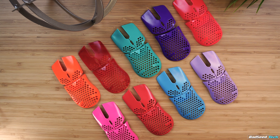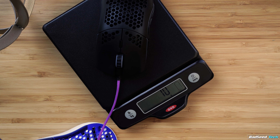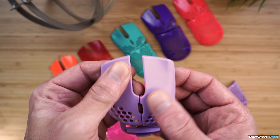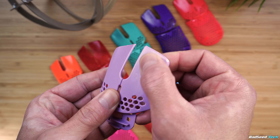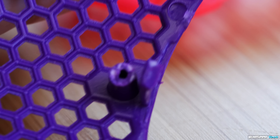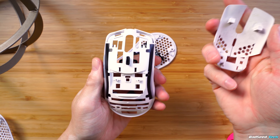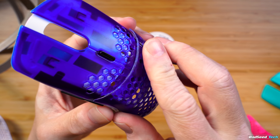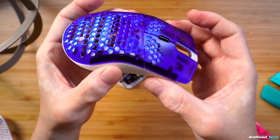Visual impressions aside, which are totally subjective, let's take a fair look at the facts. These are in essence just a visual mod — they don't seem to affect the function of the mouse at all. They do reduce the weight of the mouse by one gram. These aren't 3D printed; they are injection-molded ABS plastic. They're slick to the touch, so the coating now becomes no coating — it's not matte or gloss, it's just slippery. There are visible markings around the hexagons and a sort of grain to the plastic. The finish on the edges can be rough on a lot of copies, and there are inconsistencies where you may need to further mod it by clipping the center post or filing one side of the trigger assembly clips to install correctly. Swift Shells — I'm sorry, I really wanted to be behind this one, but the finish and the visual effect just don't justify the cost for me.